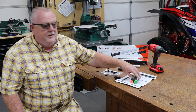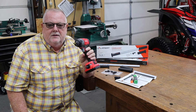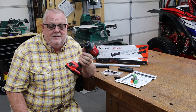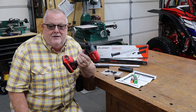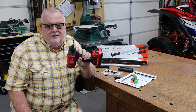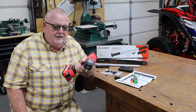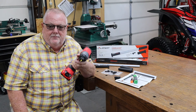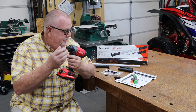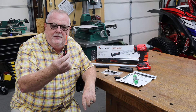All you're going to need is a screw gun or equivalent with a number two square drive. I will tell you that if you're an RV owner and you don't have a number two square drive of some sort, you best get one, because a lot of screws in RVs take this bit. A lot of people look at them and think they're Torx bits because they're sort of star-shaped, but they're not — they're a double square. This is the correct bit: a number two square drive.